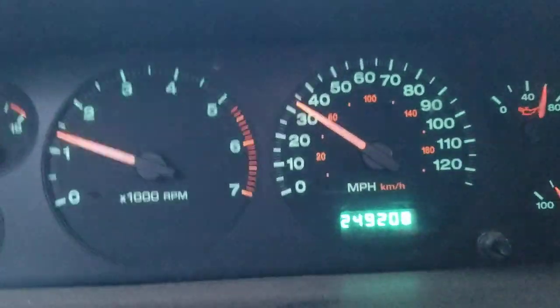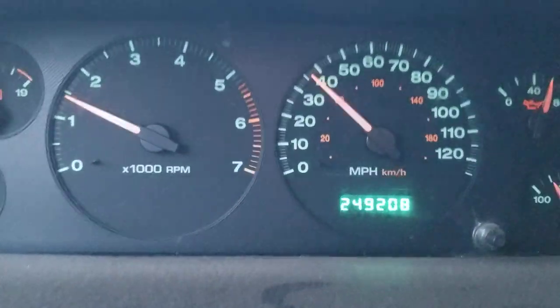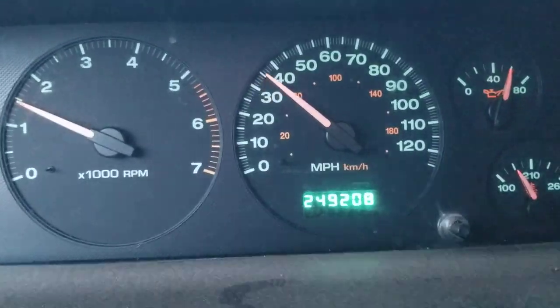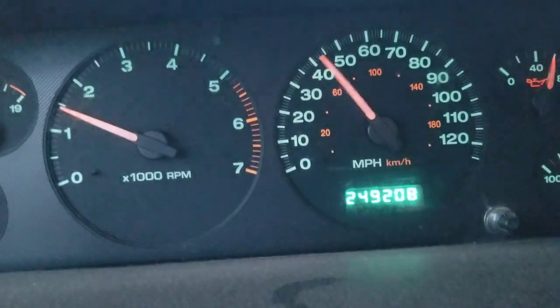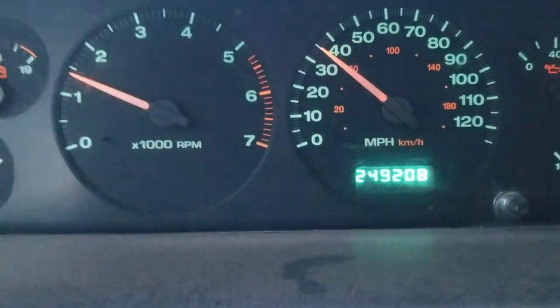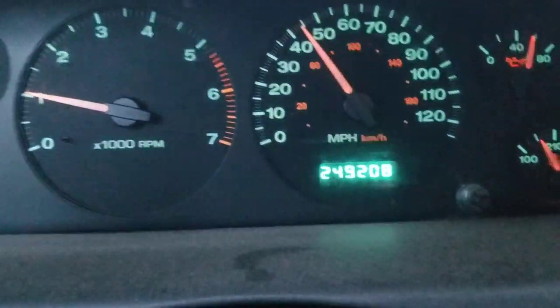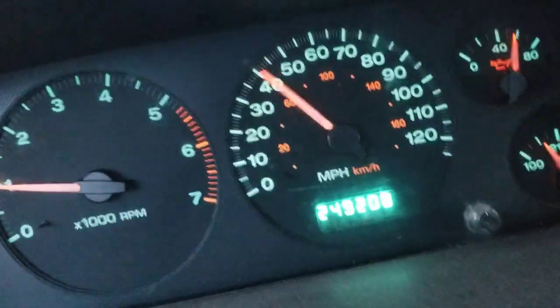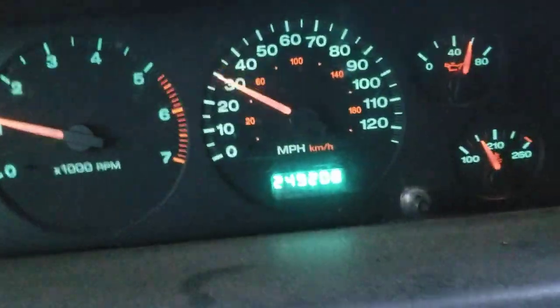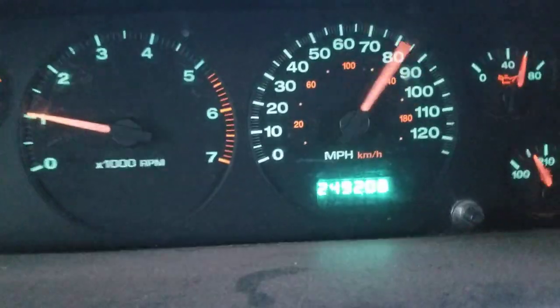The speedometer is being very erratic. I did get a check engine light code for the speed shaft sensor yesterday, but went ahead and reset it. It got so bad at a stoplight that it actually threw a code and did not want to upshift — it stayed stuck in first gear well into high RPM range, like four or five thousand RPM, before it wanted to shift. That's not good, so you don't want to drive around like that.